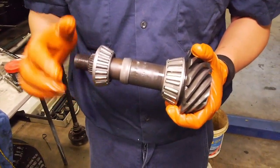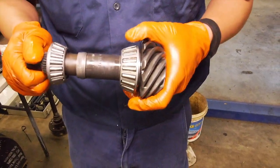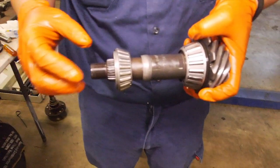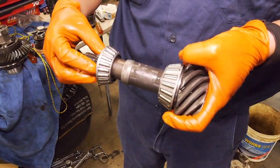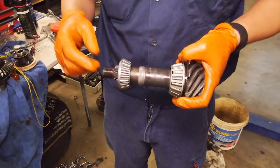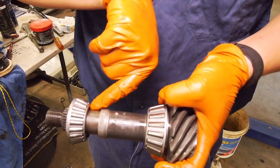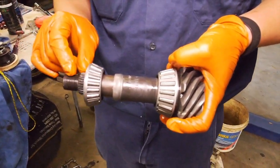What we have here is the bearing assembly as it would appear without the outer races on - that's what we're calling the inboard bearing, it sits inboard right inside against the pinion. The outer ring will sit against that here, then we have a step in the shaft, and this is the collapsible spacer that everyone talks about. Then the inner race of the outboard bearing. In the differential casing there will also be an outer ring that sits against the case. We put the tail shaft flange on and then the nut, and wind it up until we get a certain preload figure.